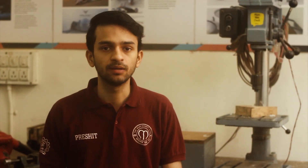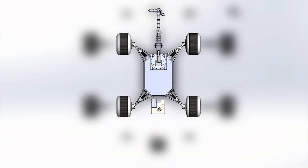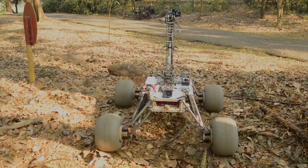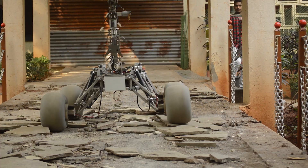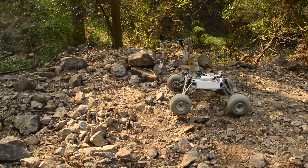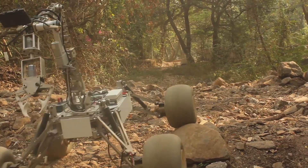The four-wheel double wishbone suspension system is designed for stability and mobility in equal measure. The wide wheelbase provides stability while the spring damper system allows our rover to climb obstacles up to 30 cm high. We have gone for differential steer this year to keep the design simple. The balloon wheels provide added cushioning and also sufficient traction. We have tested the suspension on all kinds of terrain and its performance has bolstered our confidence.